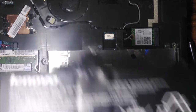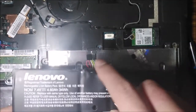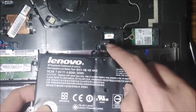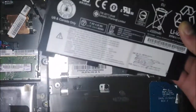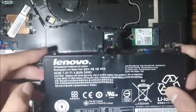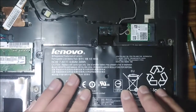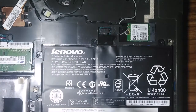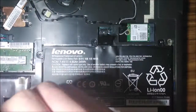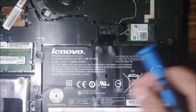Get your new battery right here. The first thing you want to do is not put the connector in yet, because it will be harder to fit the teeth back into the holes. So you actually want to start off by putting the teeth into the holes and pushing it downward. Next, get your old screws from the old battery and screw it back into these holes. Don't screw it on too tightly — just go until it's enough, not too tight.